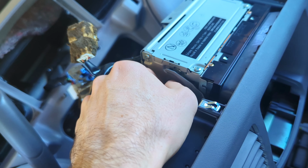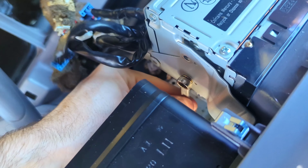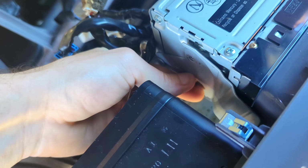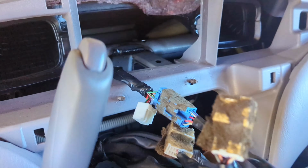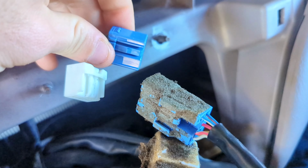And then we go in the cup holder. Or you can grab an 8mm crescent wrench, put that on there, and just go lefty-loosey. And then do the same thing, remove by hand. So I'm going to get all 4 of these bolts out and that clip, and I'll see you guys in a second. All right, so this one, we're going to press down right here, and then there it goes, unclips. The little pressure point's right there, and that is going to drop all of the pressure off of your dash, so be careful with that.